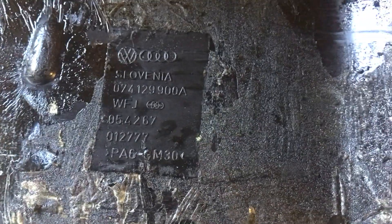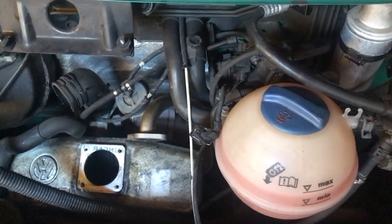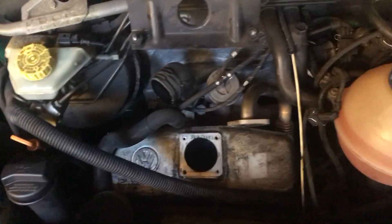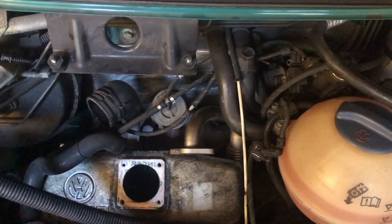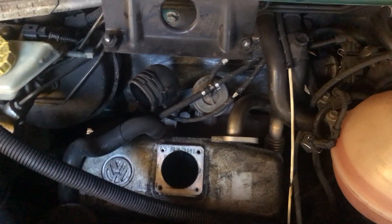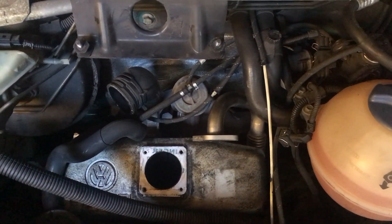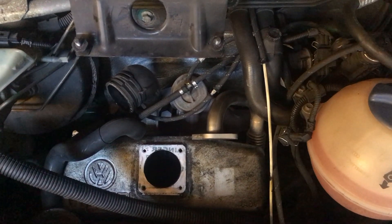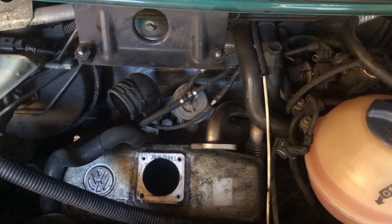There is a part number on it — I've looked online and the cheapest new one I found was about £100, and I'm certainly not going to spend £100 on a piece of plastic with a bit of foam inside, so I'll make something up. If I discover anything else or have any other useful information, I'll put it in the description — hopefully that will help you out if you have similar problems. Most people with this vintage of T4 seem to have this problem with the inlet pipe, and some people report large improvements when they fix the leak, which makes sense because you've got unmetered air going in. I'll report my findings once I've put it all back together, and whether it's fixed my starting problem remains to be seen.